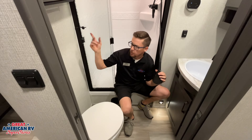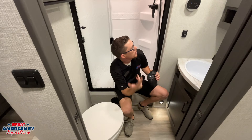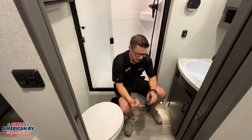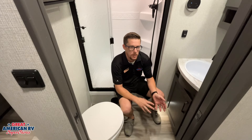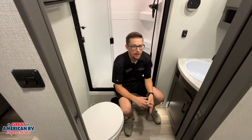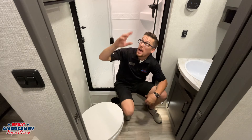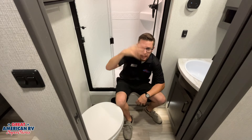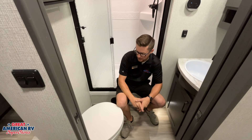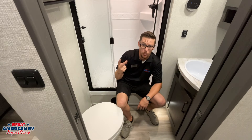In our bathroom, we have glass doors with travel latches — a good idea to put those on so you don't shatter the doors. Our shower has a hot/cold fixture. We also have a shower head that turns off and on. When dry camping without a place to dump gray tanks or using fresh tank water, conserve water by shutting the shower head off between lathering up and rinsing — rather than fiddling with the hot/cold fixture to find the sweet spot again. If you have a city water connection and a place to drain tanks, use it like you would at home. There's also a vent up here with a fan to extract steam and reduce mold and mildew.